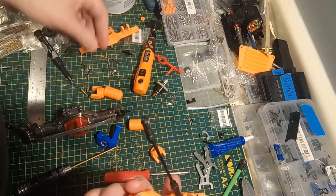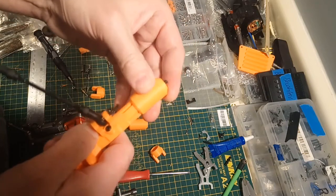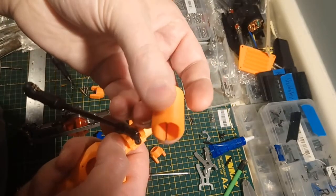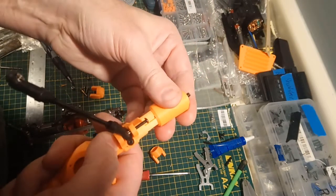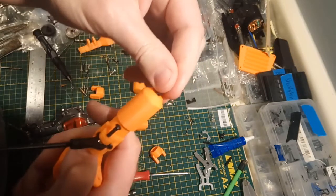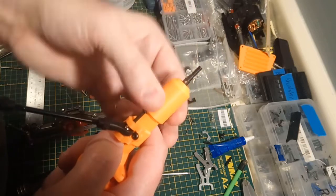We're looking pretty good — it's starting to look like something. If it's a rear axle like this, you slide on the outer. The only thing you've got to make sure you do is get the keyway — there's a keyway in there, you can see it right up top. This one's cut because it got stuck; it's really tight. So if you're doing this, be cautious and do some test fitting. Once it's on, fits like a glove. Then pushed all the way in, the pin is right there. Pull out slightly so you can put a pin through it, put a hex on, put the wheel on.